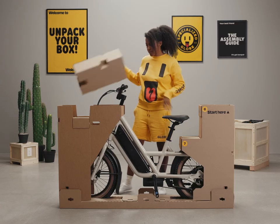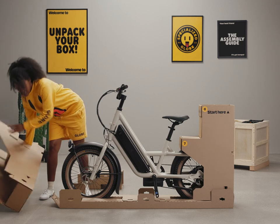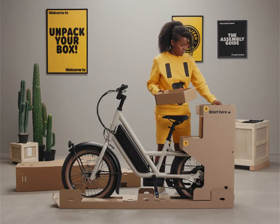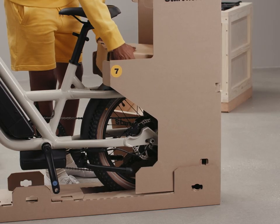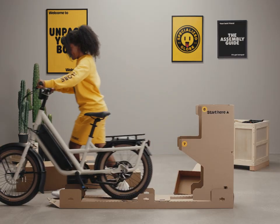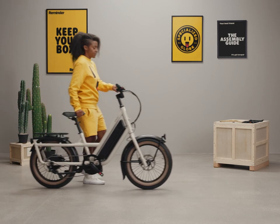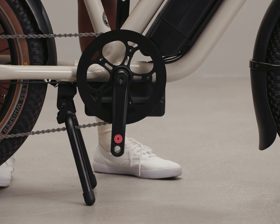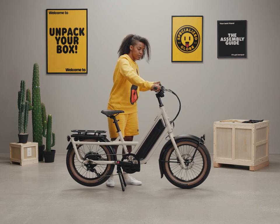We're going to unpack the bike next, so you can finally remove the center tower. Unlock the tab on the front tower, then slide the tower and the wheel brace off. Now let's go back to the rear tower and unlock the tabs at the top. Remove the small parts box tray as well as the tower caps. Unlock the bottom tabs and remove the lower rear insert from the tower by pulling up from the back of the insert. Hold the rear tower and roll it forward to release it from the packaging. Now hold the bike up and use your foot to lower the kickstand. Hold the handlebar and roll it back so the kickstand swivels under the bike to fully support the frame. Be careful to keep your foot on it so it doesn't slide backward. While the kickstand is strong enough to support the weight of the bike and its cargo, please note that it's not intended to hold up an adult.